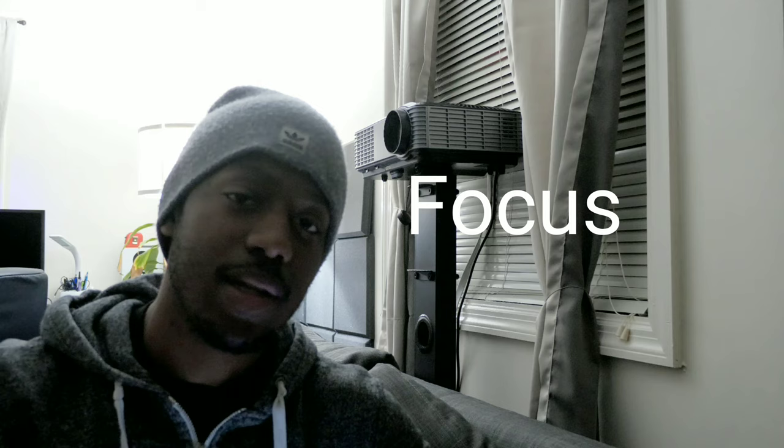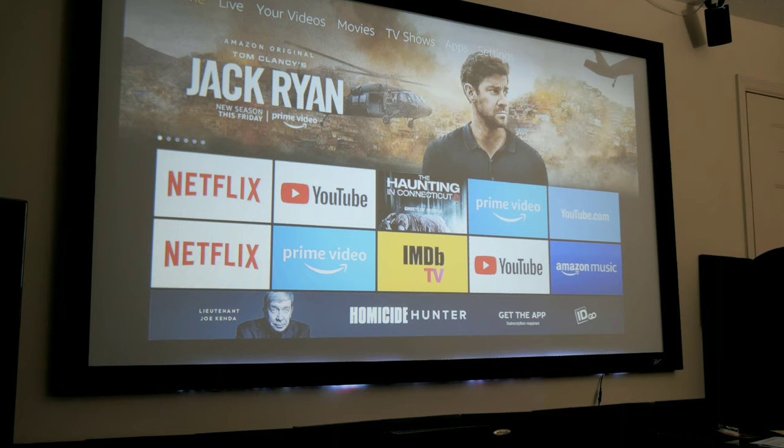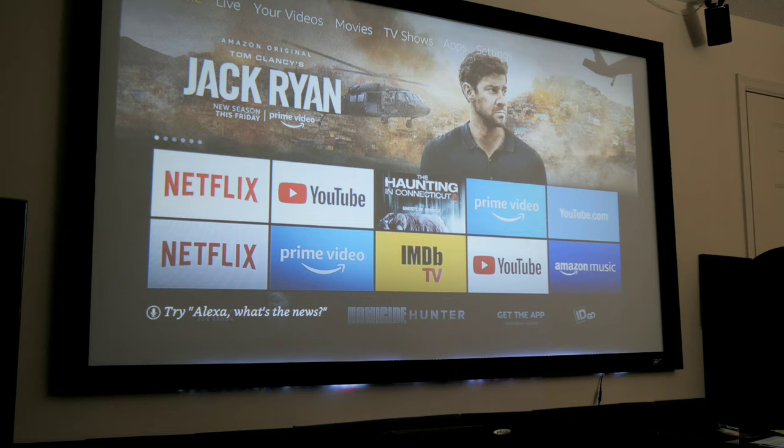One of the things I've been battling with my projector since I've had it is focusing the image. Most of my image is focused, but every now and then the bottom right or top left corner is out of focus — those are some of the hardest parts to get right. Positioning has helped with that, but you also have focusing you can do with the lens. Some projectors let you physically turn the lens to dial in focus, or there may be a rotator above the lens on the projector to help you settle your focus.